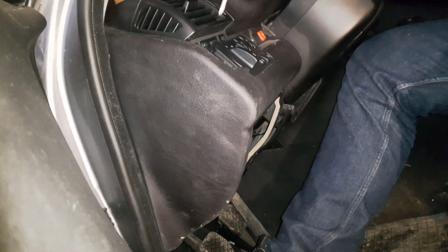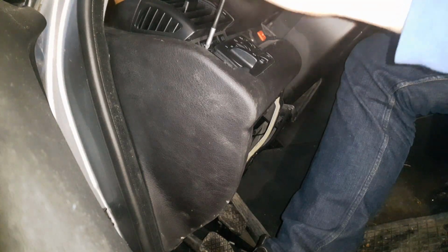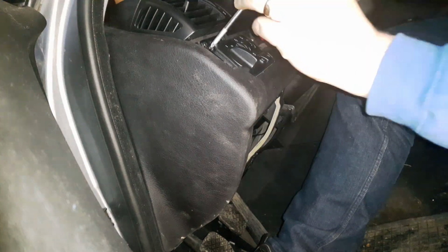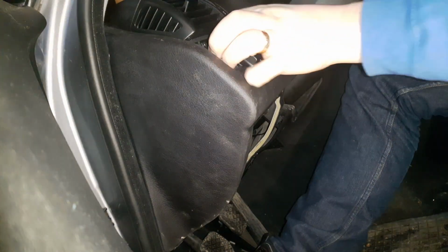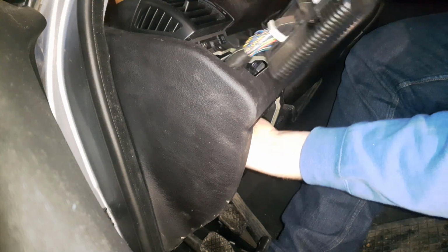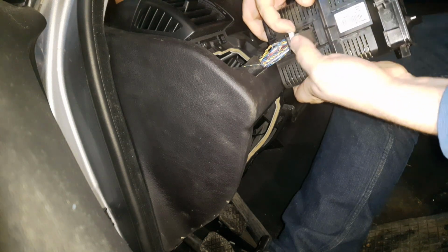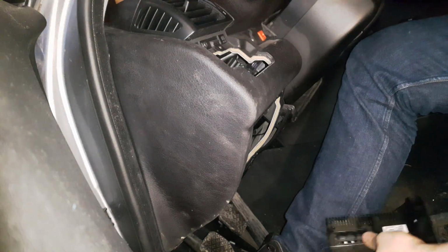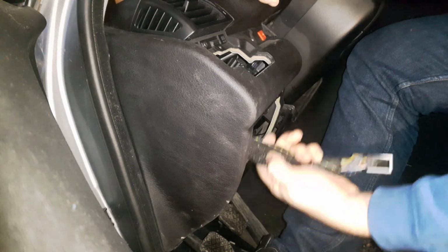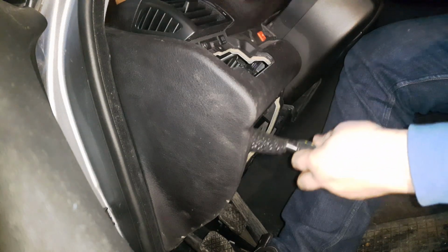Then this is held in place by 2 Phillips head screws, but one is missing, so let's unscrew the other one. Pushing it from the inside is a bit easier. So then push this tab and this white piece will fold right over and push this out. So right like that. And this removal of the glove box will get you way better access to this than if you try to work around it from here.